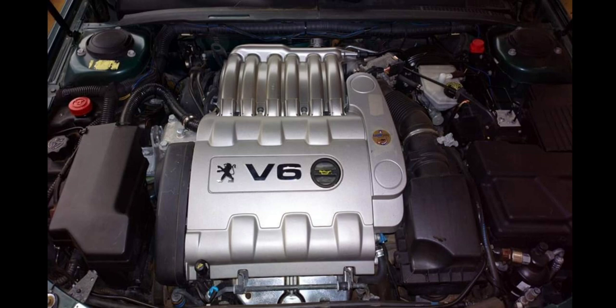So that gap, if you are washing any EW engine, not just the EW10J4 or EW10, you will find that water sometimes comes in while you are spraying. It will flow from the thermostat housing on top of the radiator housing, and then flow into that ignition coil chamber or spark plug chamber and flood that place. It will penetrate and settle on the spark plugs. Sometimes it may even affect your ignition coil and damage it. But mostly it settles on the spark plugs. When you try to start, the car will be misfiring. Sometimes it may not even start because water has flooded that place.